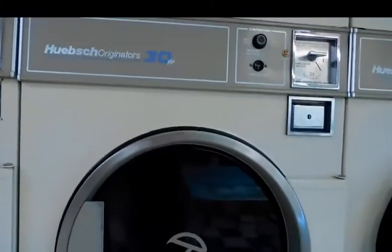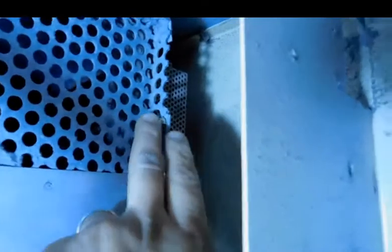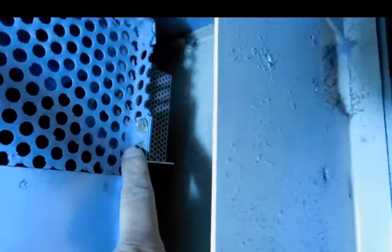So we're gonna go in the back and check. Usually for this dryer, when something like that happens, you're gonna have to take this off — these two bolts off. That way you'll be able to see the limit switch. The limit switch is located right there behind this.